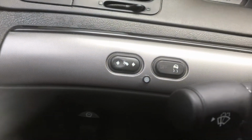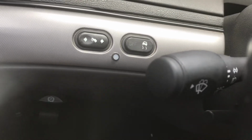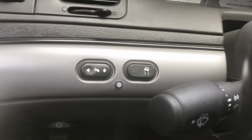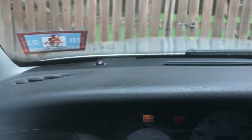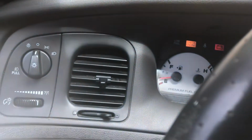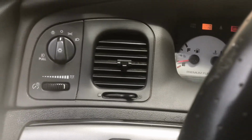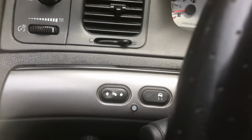This right here is an LED that was actually drilled in from the dealer, and if you trace the wires back, it leads to your PowerCode or CodeAlarm module. This module essentially works in parallel with the original PATS system, so your car technically is protected by two individual security systems. That's why you can have one fob for PATS and another fob for PowerCode. In my case, that's exactly what's going on here.